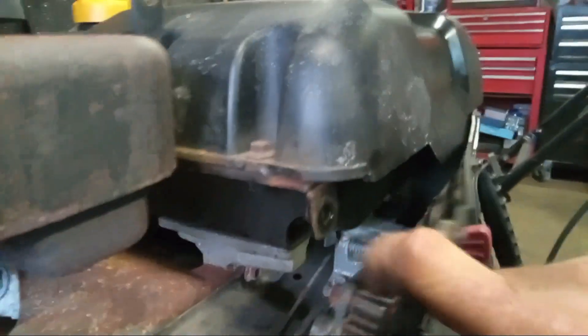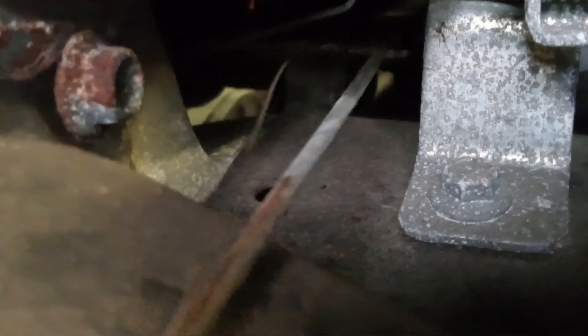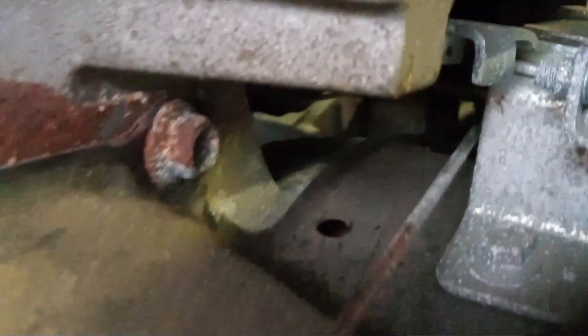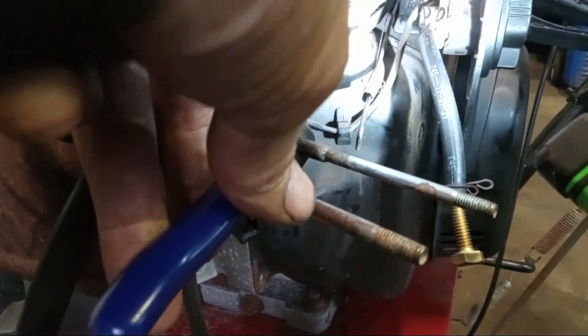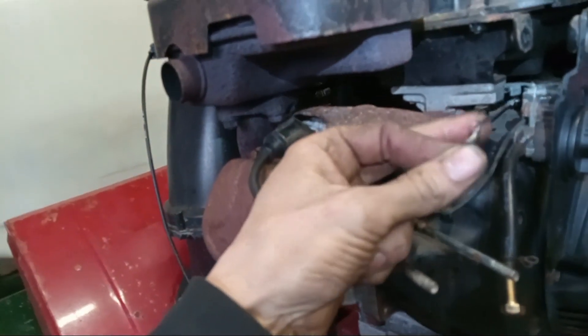You should be able to pull forward on this a little bit. If I pull this throttle forward, you can see where it actually pivots on there — and that's where our spring is connected to. It's hard to see with the camera, but when I get my new spring it's just enough to get my hand in there and place it back down. There's a little hole in there which is hard to see on camera. Basically I'm going to use long-reach pliers to get all the way down in there to where that spring's hooked, and I'm just going to pull up on it and pull that spring right out. Once you have it unhooked, you can pretty much just slide it right off of your throttle cable, just like that.